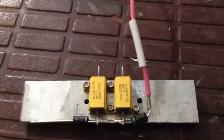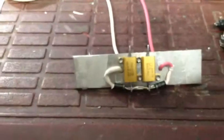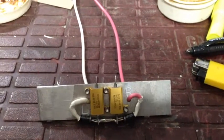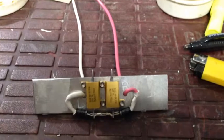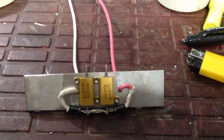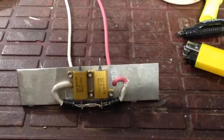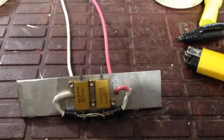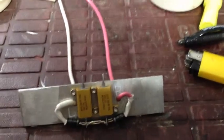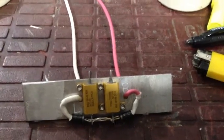I've attached the red wire, which I'm going to use for the right side. I marked the plate left and right, and I want to slide some heat shrink over this termination to give it some protection against touching ground. You can see that the left and right wires that will go down to the turn signal module are installed in this plate. You can use some hot glue to help hold these wires down if you want — by using the heat shrink you'll isolate the wires from ground, which ought to be good enough.